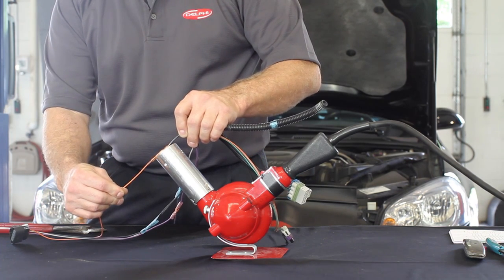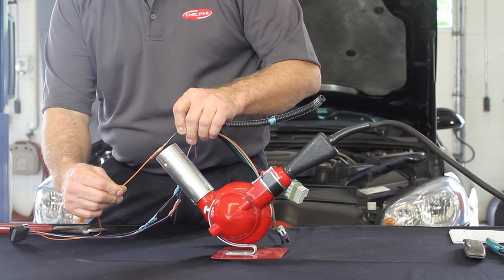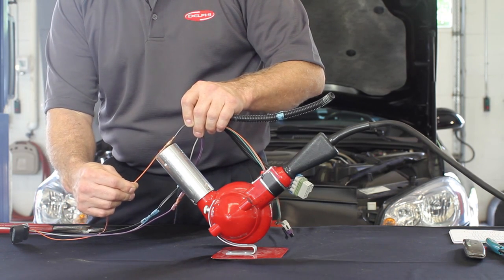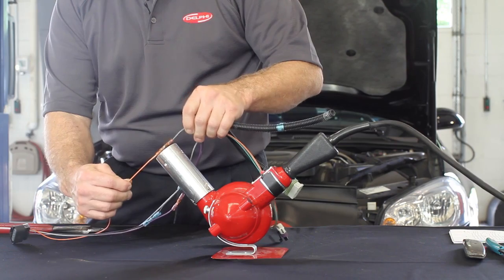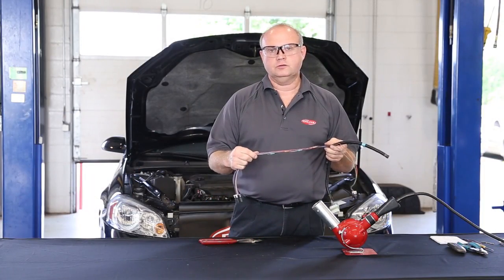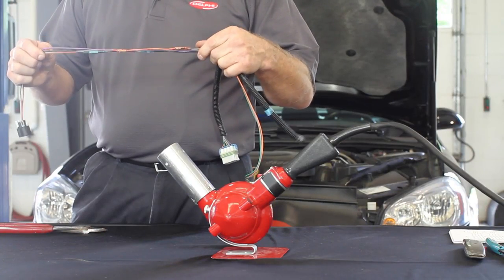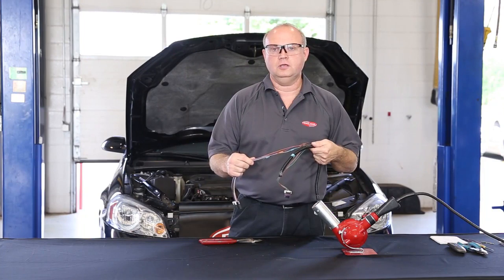And it'll be completely finished when you see the glue start coming out of the connector itself. It means it's sealed. Now you've got a finished product, staggered connections, nice weather-tight seals. Finish up by reinserting it into the conduit, wrapping up with any electrical tape that you need, and you're all set.